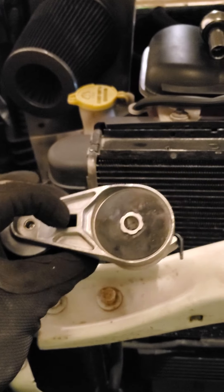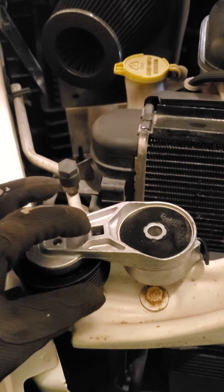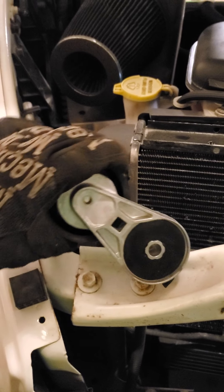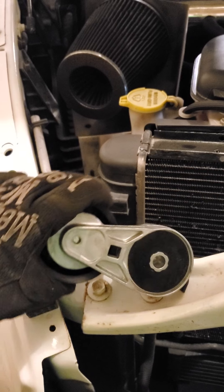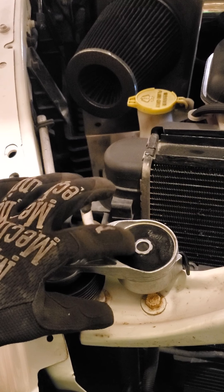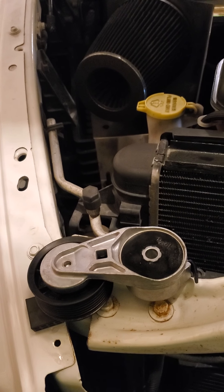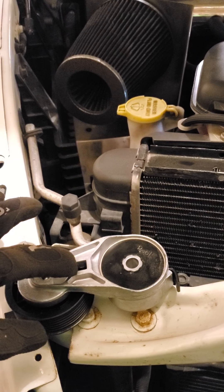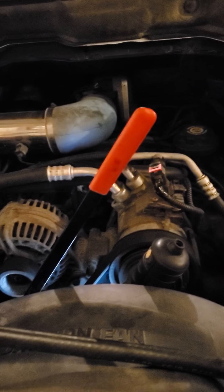You can see this little hole right here — 3/8 inch socket drive. When you stick a tool in there, either 3/8 inch or the tool I'll show you in a second, you're going to turn it to the right to remove the tension on the belt, then pull the belt gently off so you can replace this part. Then remove a 15 millimeter bolt, pull off the part, put the new one on, put the bolt back in, loosen the tension, reroute the belt, and you're done. All you need is a 15 millimeter socket with a ratchet and a 3/8 inch drive tensioner release tool.